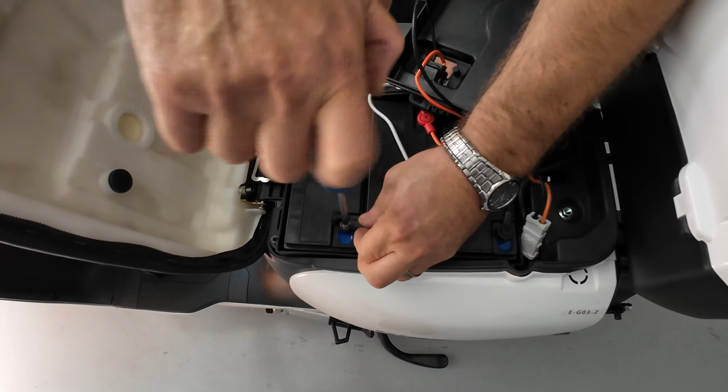This battery pack has 2 batteries inside, and this battery pack has 3 batteries inside. I'm not going to open and show you any of that because you already saw it on this sample. And when you're charging batteries, they work in series, so you will have to plug them into each other, and then with your charger you don't need to plug into the scooter anymore. You just plug in directly to the top battery, which is right here, and then now you see the red light. After it's done charging, it's going to switch back to the green mode as a standby mode.